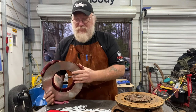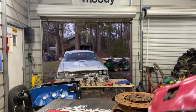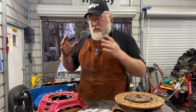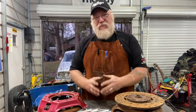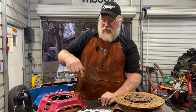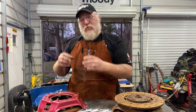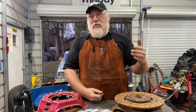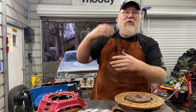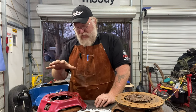Inside here you can see springs. These springs have a rate just like any other spring. Without the paperwork in front of me, say they're 500 pounds base pressure - that means they have 500 pounds of clamping force on this clutch when you let off the pedal. Every turn you put in has a progressive rate - it doesn't go one turn equals 100 more pounds evenly. If it's 500 base and you turn it one turn, that might be 750. One more turn might be 1,200. It has to do with the spring rate that RAM has in there, and you get paperwork with that.